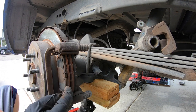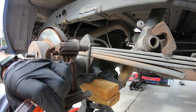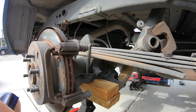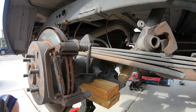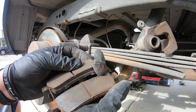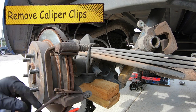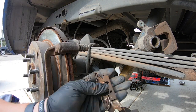There's not much brake pad left on these. Use a flathead and a hammer with a little persuasion to pop the pads off. You can see one was almost down to the wear indicator even though the inside had more material — that is definitely time to change your brakes. Go ahead and pop off the old brackets too because the new kit comes with those, so that's all we need to take apart at this point.